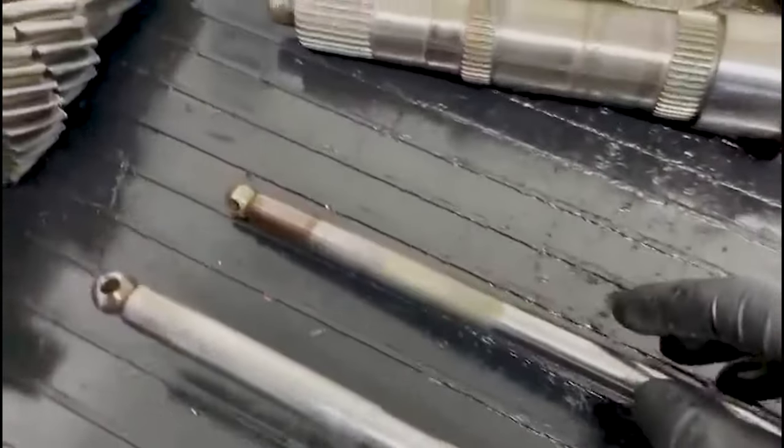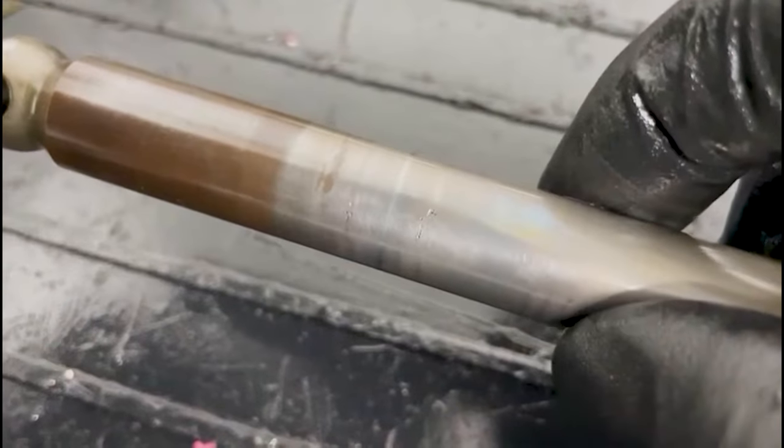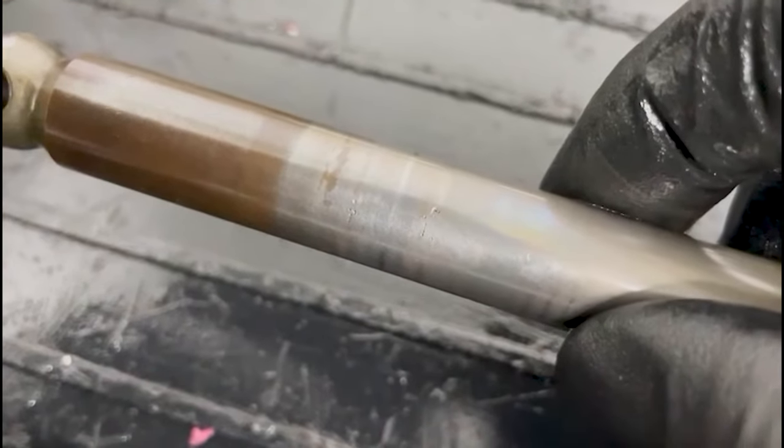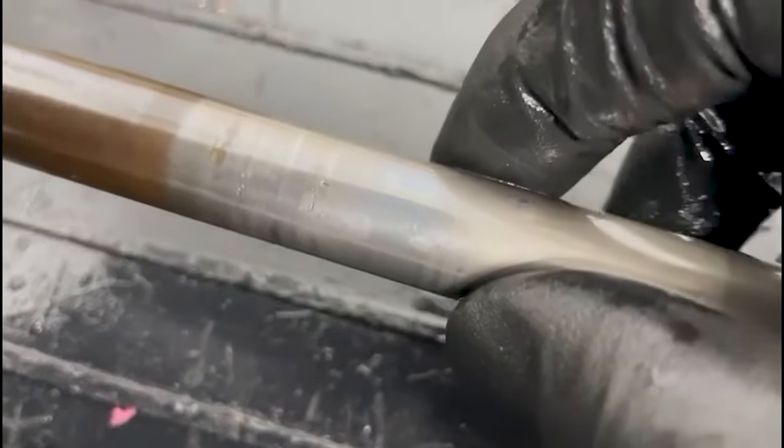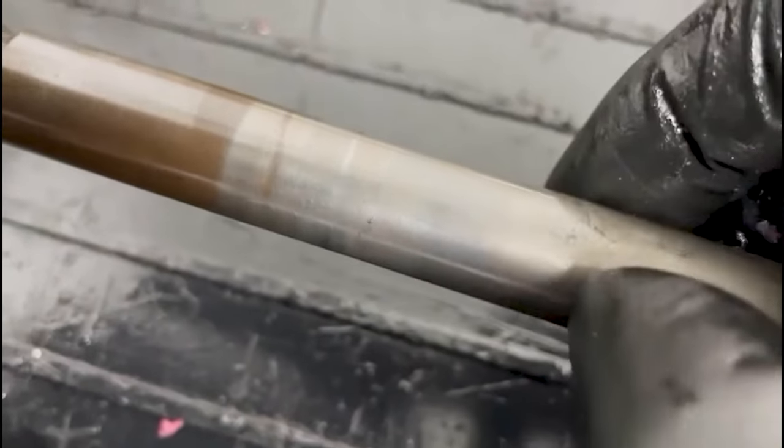And then the shaft, which is all about the select shaft. If you look closely, I don't know if you can, yeah, you can see it. You see the little pretty corroded hole there and there. That's right where the seal sits. So if we run this, and there's some more there, you see. That's the corrosion which has caused that. If we run this, that is likely to leak.